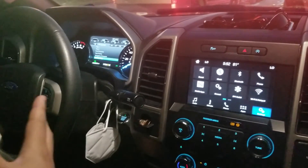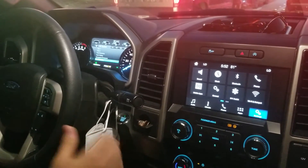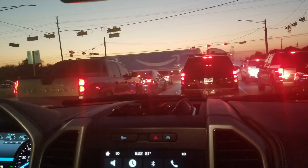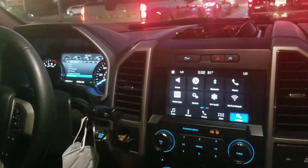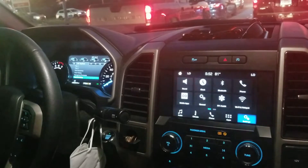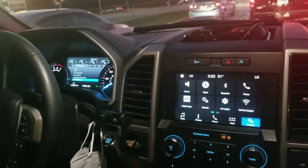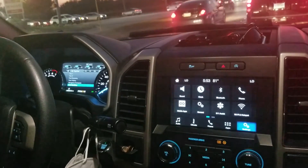If I'm in a hurry and I let go of the brake and immediately accelerate, I've heard the engine not start or hesitate or sputter. Sometimes that starter does not go as fast. After enough seconds it'll kick on by itself even if you're still holding the brake down. If you're at an extremely long red light it will kick on automatically, probably because of personal comfort and air conditioning.